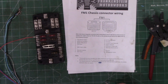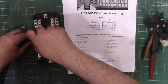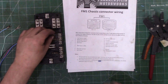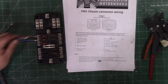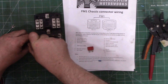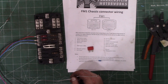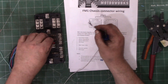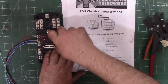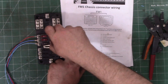I'm just taking a guess at these fuse values — if something blows I'll go look it up, but don't take these for gospel. We'll put 10 amps on fuel injectors, 10 amps on ignition coils, another 10 amps for air-to-fuel ratio sensors, 7.5 for that one, then MAF power. For drive-by-wire power we'll give it a 10 amp, and then 5 amps for the mass air flow sensor and the purge solenoid.